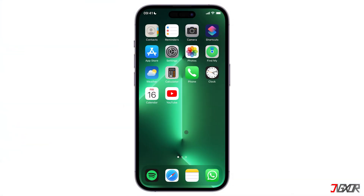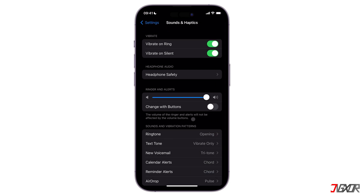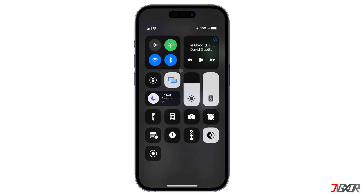You should also check your sound settings. Go to Settings, then tap on Sounds and Haptics. Make sure that the ringer and alert slider is as high as your preference. If you notice that the speaker icon on the sliders is grayed out, your iPhone needs to get repaired. Remember that a Focus mode can mute all sound — you can disable it by opening Control Center and tapping on the enabled Focus mode.